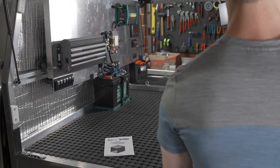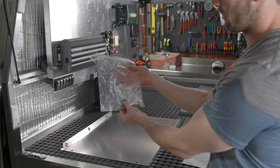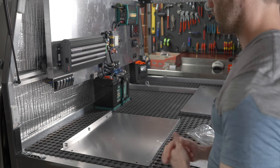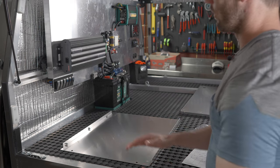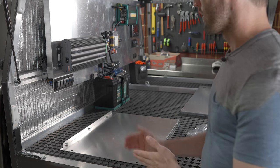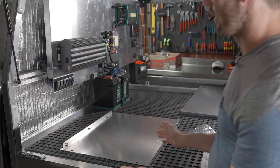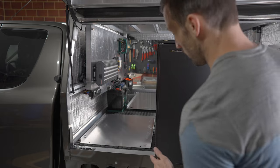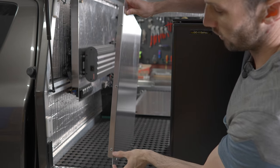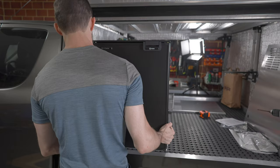The fridge cage is basically a cube without the front face — nice lightweight aluminium. It comes with self-tapping screws, a bushing for cable exit, and a bag of screws. You'll need to provide your own canopy mounting solution — nut-certs or self-drilling screws. Get the base where you want it, build the cage around the fridge. The base plate is not reversible — the long side goes toward the front of the fridge. To figure out how far forward the fridge sits, line up the side panel's three holes with the three holes along the bottom of the base plate.